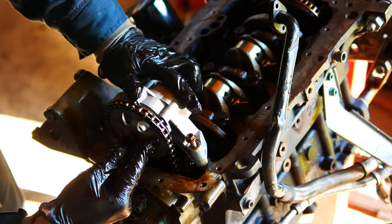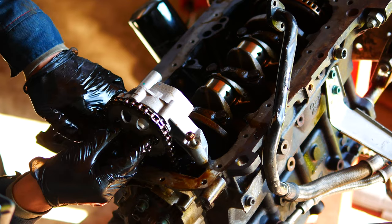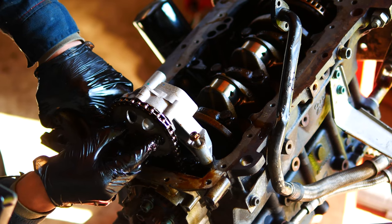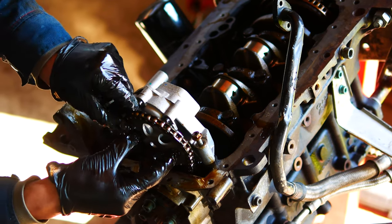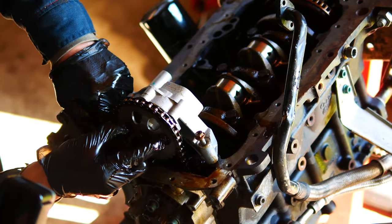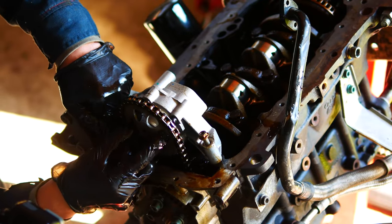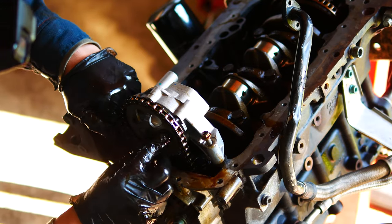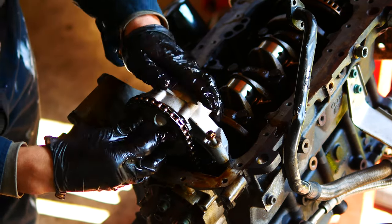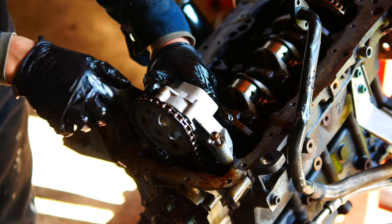and then line up the thing. So you've got to just push on the tensioner there, so you're able to put the cog all the way back. But you can see that's a little bit not right. So I need to turn this one more to the left. See how that goes. Nope, still not. Let's do that. Cool. And then that pushes. You can see that's pushing on. There, then I can release the tensioner. And I'll just do these hand tight for now.